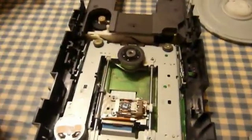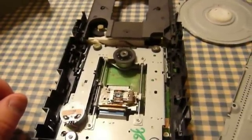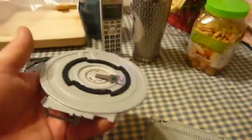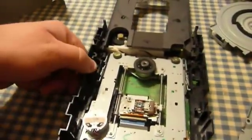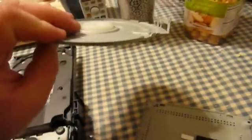So now I've just got to clean the lens, and then I'll throw this drive back together and see if it actually does read discs. As for the top cover, it did take a little bit of violence to get it off. I just carefully levered this plastic frame out until these metal tabs disengaged, and then I was able to carefully lift it up and away — and I only bent it a little bit, so I get some bonus points.